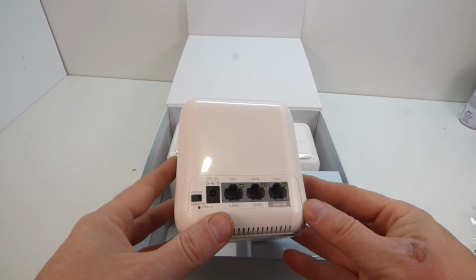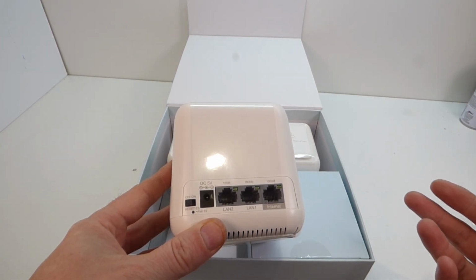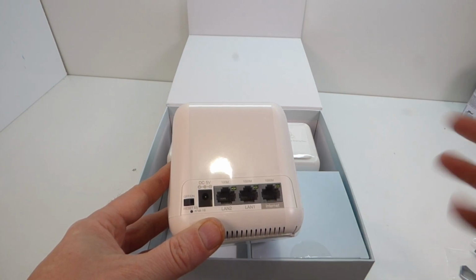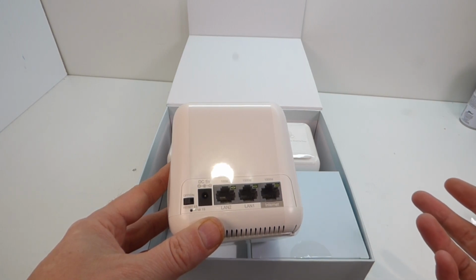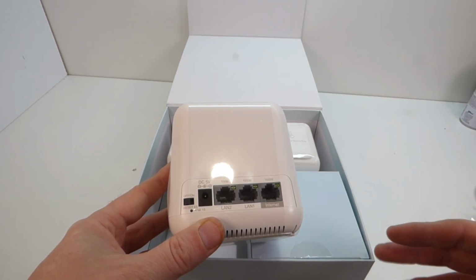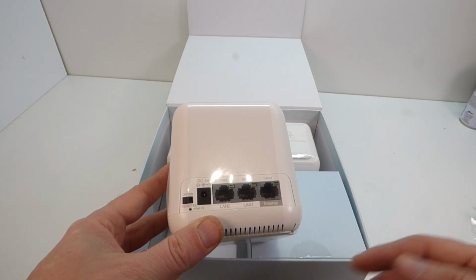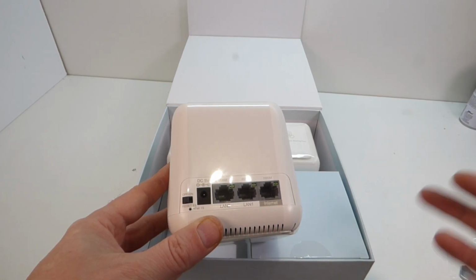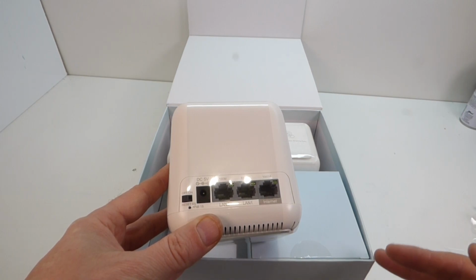So what you do with this is you put this next to where your internet comes into the house, which is usually a router with a modem built in. If you have an older BT Infinity, you'll have an OpenReach modem, so you're actually lucky there, because you can throw away the BT hub and just plug your OpenReach modem straight into here and let this do all the work. If you have a home hub or a smart hub like I do, unfortunately everything's built into the actual router and you can't disable anything and put it into a modem only mode, so you would have to switch off Wi-Fi, disconnect any LANs from the back you've got, plug them into this instead, or a switch, and then just loop it. And you're double natting, which isn't ideal if you're trying to access security cameras, etc. on your mobile away from the property, but that's pretty much your only solution really.